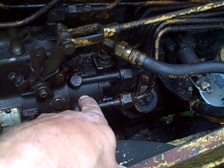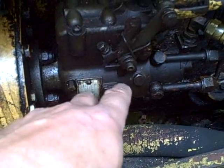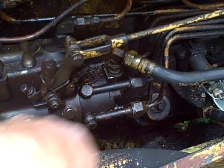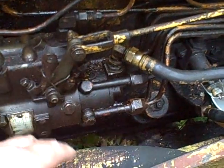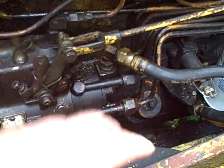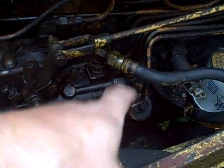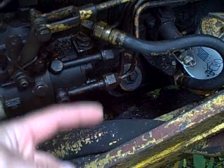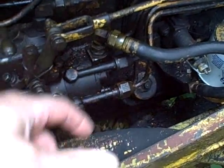The transfer pump basically helps bring that fuel in to the injector part. What you've got is a transfer pump in one section that transfers the fuel to the actual little plungers that compress it and send it out through the various injectors. And there's a distributor, almost like a rotor, that as it turns around decides which injector to fire that compressed fuel to.